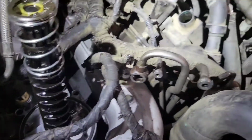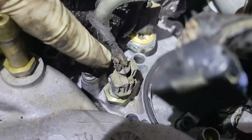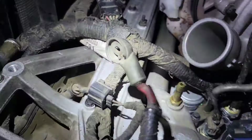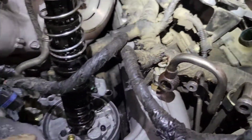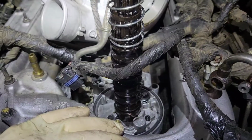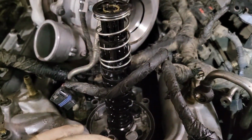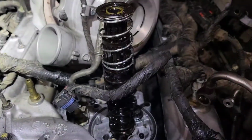And then now I'm gonna go ahead, I left all the harnesses loose. So now we can wiggle this around. Make sure you've connected all your connectors, oil pressure, fuel temp, manifold absolute temp. Get your glow plug harness back on. Don't put your alternator on till last. So now I'm gonna go ahead and put my blue spring kit in. And put this in. It should be straightforward from here.